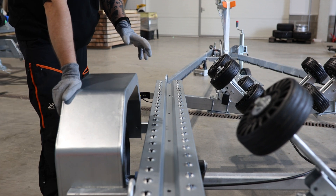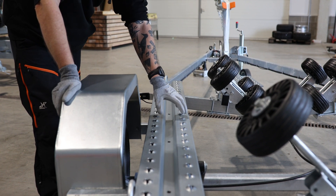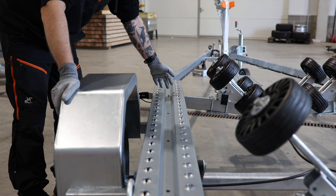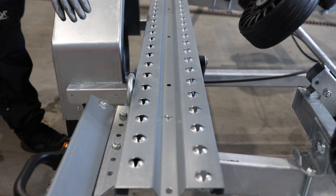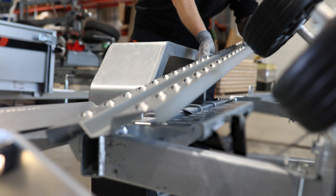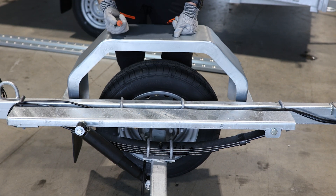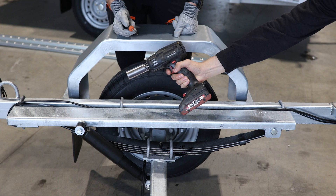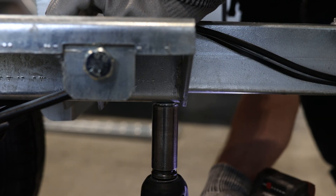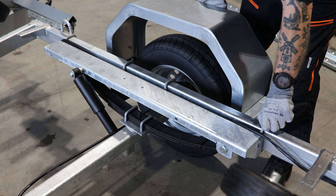The actual adjustment of the axle position is fairly similar on all Respo multi-roller models. On some of them, like this 1000 kilo boat trailer, you have a gangway installed on the side — the first thing to do is remove it by loosening the bolts here and over here, then lift it off. The axle assembly is held in place by four U-bolts on each side, and to loosen them all you need is a 19mm key or a spanner. Once you've removed all the nuts, remove the U-bolts on both sides.